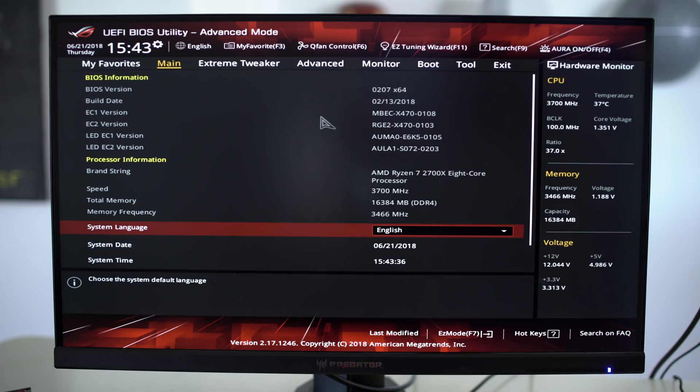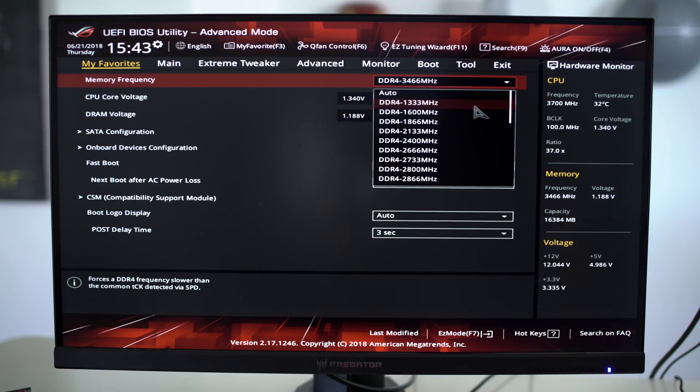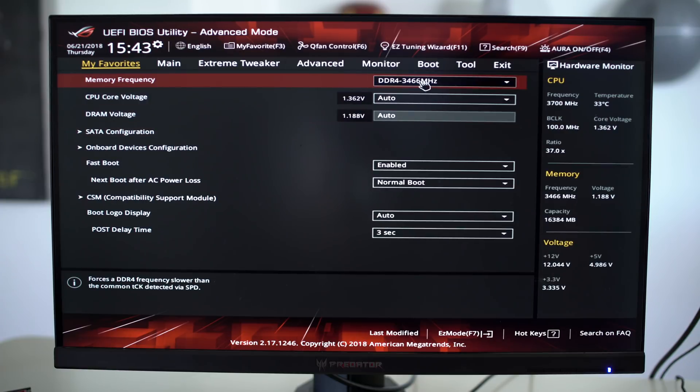On the Crosshair Hero 7 however, all you do is go in and set your target memory speed. So if you buy memory that's 3,466 megahertz, you just easily set the target speed to that and as long as it's meant to run at that speed it boots up and runs no problem. We had no problem setting the first memory at 3,000 megahertz, then we changed it out to the other stuff — changed to 3,466 megahertz — and everything ran without a problem at all.